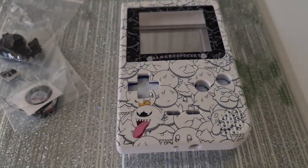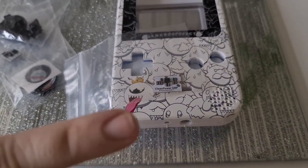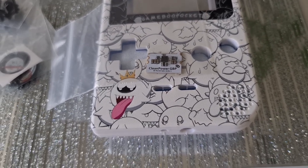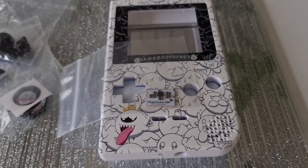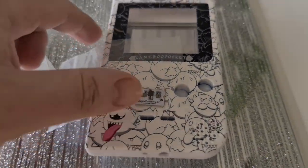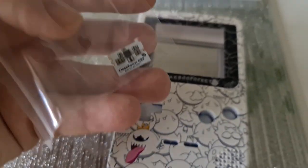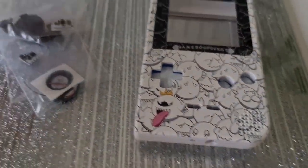Next thing up, we have the clean power mod. I can't get over how small these are — I've got quite chunky fingers but damn. We've got this clean power mod, and this is going to replace the power board to give it a cleaner power output, a more stable, less draw, and actually help with powering the screen more efficiently. I'd recommend getting this as well. It's a diddy little board — it's very cute.